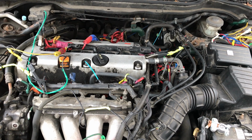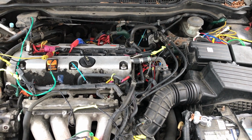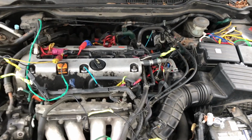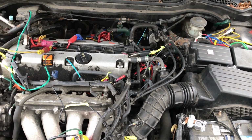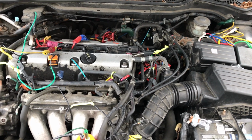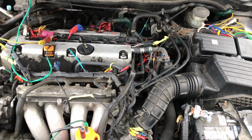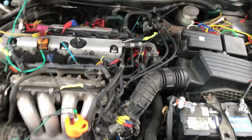If you think you may have a noise that's associated with the GDI pump, you would probably put a microphone near the GDI pump, maybe put another microphone on the other end of the head, and you know that the noises coming out of that GDI pump will definitely be in sync with the PCM command to the fuel volume solenoid on the GDI pump. So basically, I don't want to turn this into a GDI class, but there's definitely an electronic acoustic relationship. But nonetheless, that's where we stand.